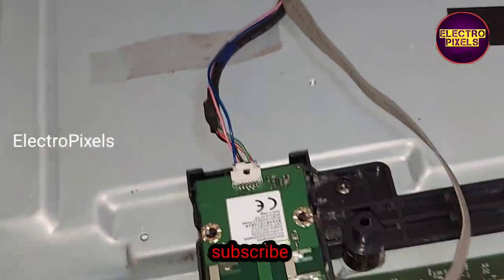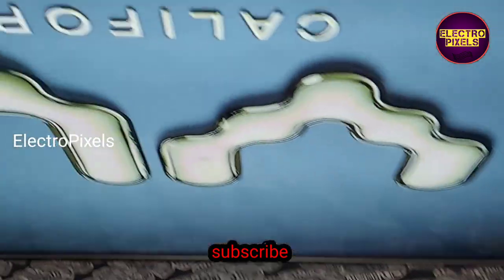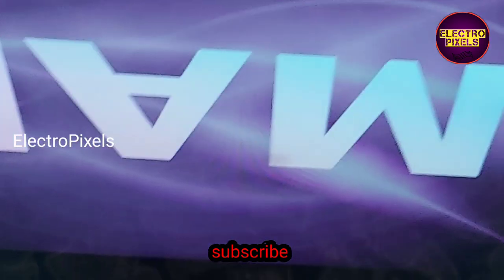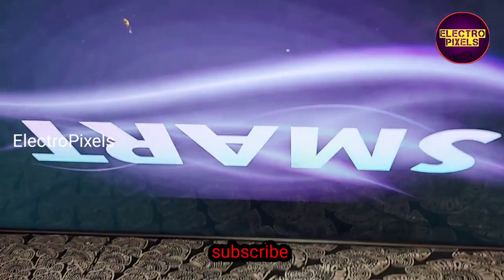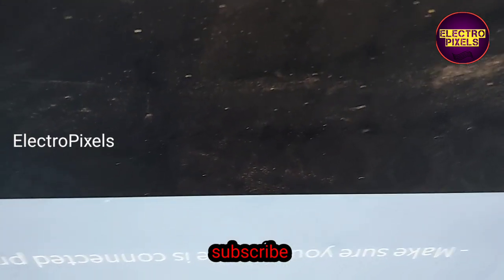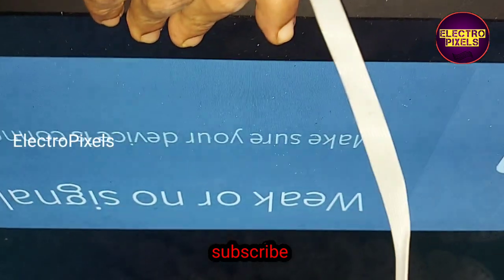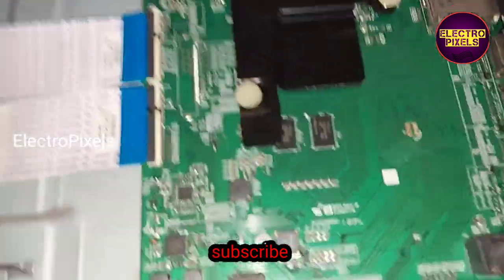Note that this is only a temporary solution — the permanent solution is panel replacement. Now the picture is clear. After blocking the gate signals, there are no horizontal lines on the screen. The picture is crystal clear and the TV is repaired successfully. The internal shorting has been removed from the right side of the panel.